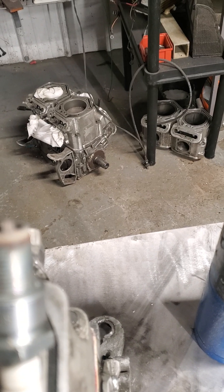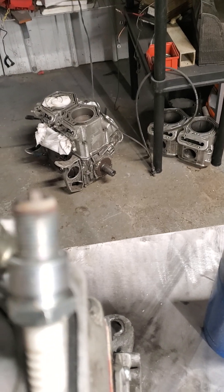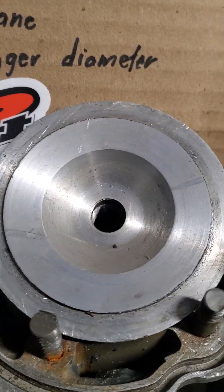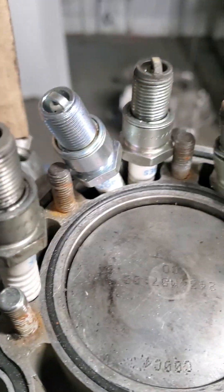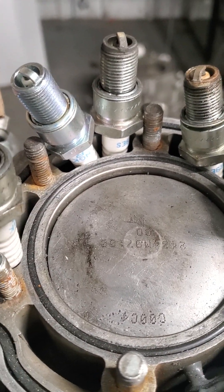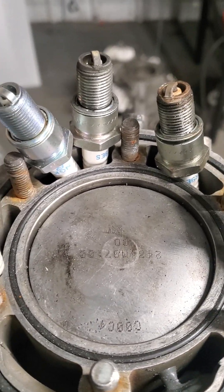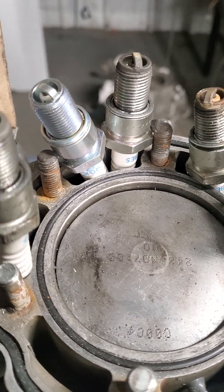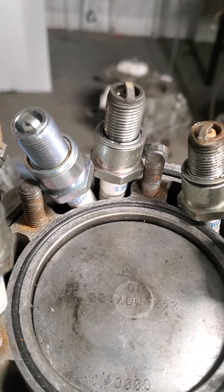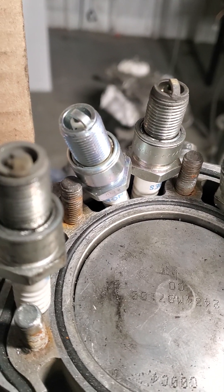So at least two jets richer than our drag setup. We run an air-cooled head, which is another misconception — everybody said we had to have liquid heads. Now in a five-second run or even an eight-second quarter mile run, where I have the national record at 160, an air-cooled head is fine. Road racing, motocross, or that — then your liquid head, once your motor and everything stabilizes, will help you.